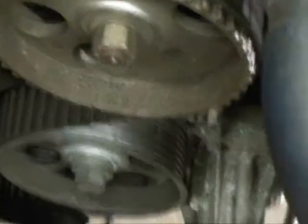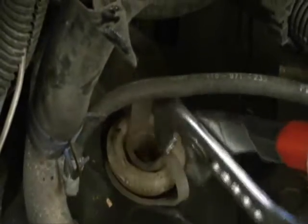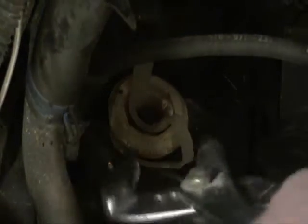We're back at it — got the belt off, took the lower cover off, and got to take the pulley off the water pump and the pulley off the crank end. Once you get all that, you take the plug out of the back end of the transmission — right down in here. It's a nylon plastic cap on threads and they get brittle in time; you've got to be careful or you'll break them. With this plug out we'll be able to see the marks on the flywheel back here so we can position the engine at top dead center, and once we do that we can begin to take the belt off.